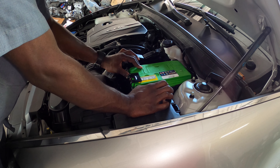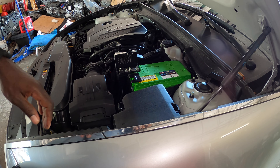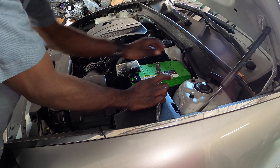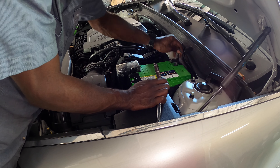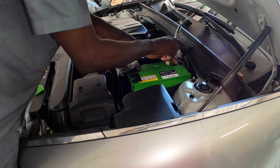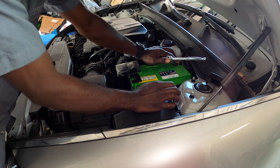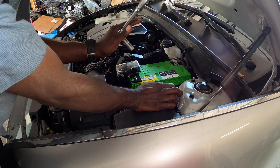Now what you want to put on first is your positive cable — just like that, positive cable. That doesn't have to be too tight either. Then get your negative cable. You see how this touches right here — well because it's negative it doesn't do anything, but make sure when you're doing the positive it doesn't touch anything.